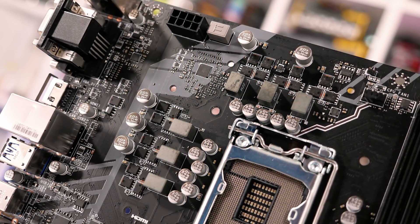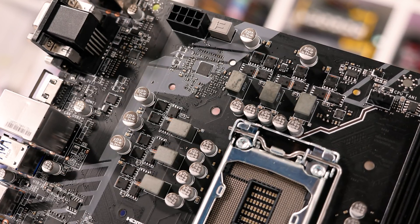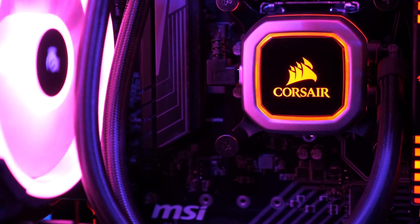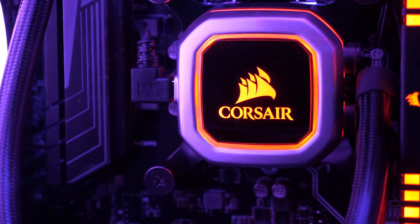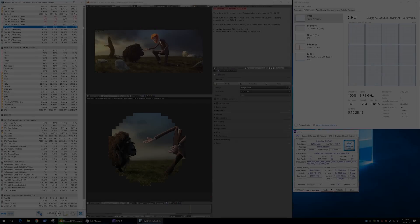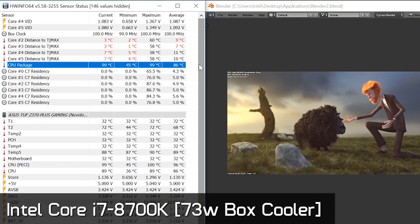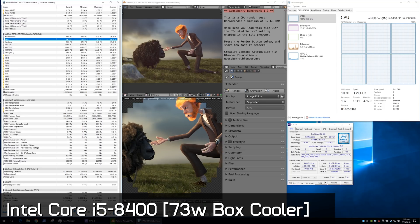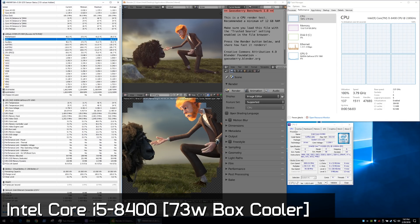In a previous video we bought a few of the worst Z370 boards we could find and tested them with the 8700K using the box cooler that comes with the 65-watt locked parts, then compared them to a cheap air cooler as well as a high-end all-in-one liquid cooler. The 8700K is a 95-watt part so the cooler was obviously underpowered, however the Z370 boards let the 8700K reach the maximum temperature before thermal throttling kicks in — otherwise known as TJ Max — and the performance drop wasn't that bad.